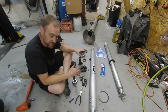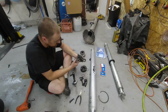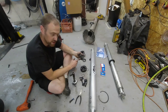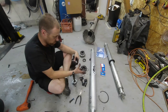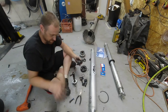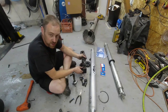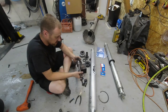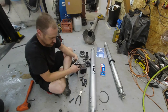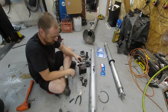Doing this can be done without a press, but I highly recommend a press. You can separate these bearings without a press — it's definitely possible. You could also get creative with bolts to pull everything in place since there's a hole through here. But honestly, you can just set it on an iron block or the floor and pound the bearings on with sockets. It is nice to have a press to get it off, but not fully necessary. I typically just take my hammer and tap it, turning it and going until it finally falls off.